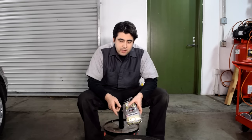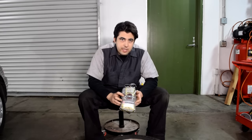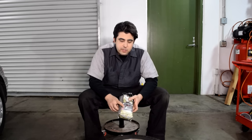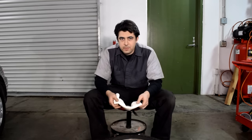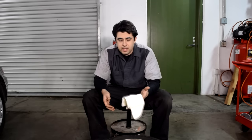We're going to be applying our Noxon with some ultra-fine steel wool. You want to make sure you get the ultra-fine steel wool — this is the one with four zeros on it. Because if you get any of the other kind, you could potentially scratch up your chrome. And to clean up, just a couple of rags — it doesn't have to be microfiber towels, it could be any cotton towel, really. And last but not least, some elbow grease, which I'm sure we've got plenty.